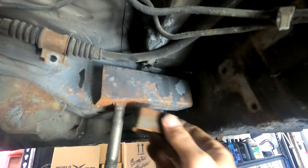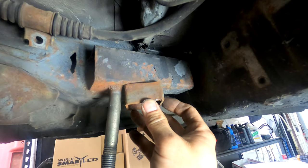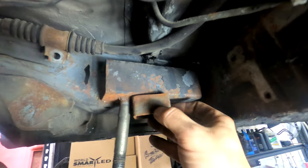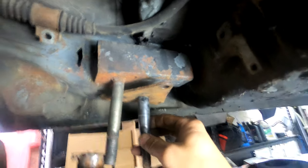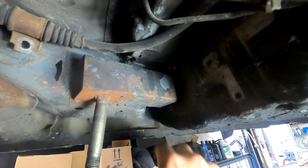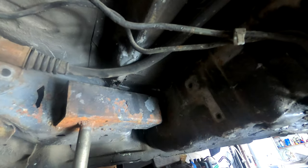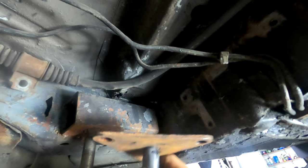The good thing is the angle it's at now is where it needs to be. If you remember I had this spacer here — where it sits like this is essentially the perfect pinion angle, so that's all set. What I basically need to do is replicate this, and that means we're going to have it somewhere right in here — not here, a little bit lower. I'm thinking square tube steel on an angle like a triangle, with a point here and a point here, welded in.